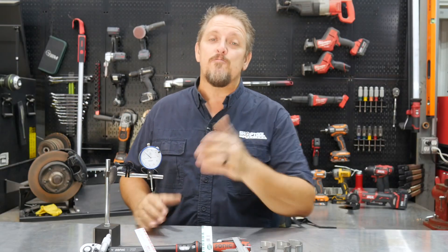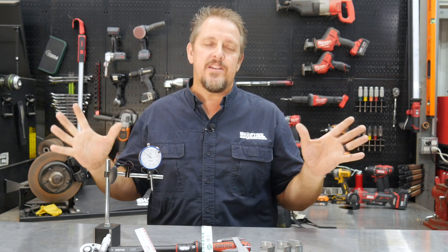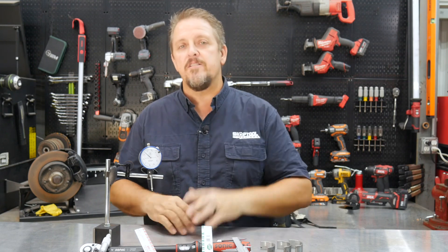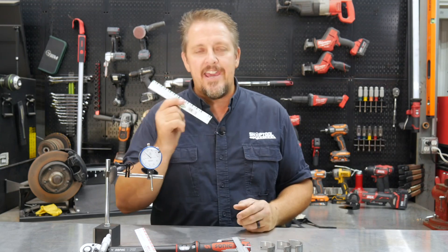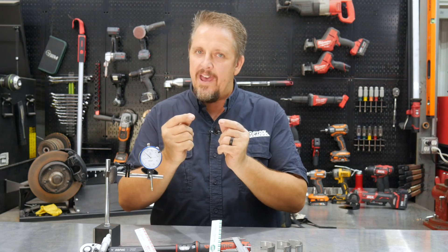The bearings checked out: 300,000 miles and still well within tolerance and service limits. You may say there's no way you'd use 300,000-mile bearings, and that's fine — spend your 40, 50, or 100 dollars and replace them. I'm taking the chance and think they'll be fine; we'll follow up. The plastic gauge is really neat how it works, and it's more than just taking measurements — get a good look at how it falls all the way across the bearing face and check for any variances in width. That tells you a lot.